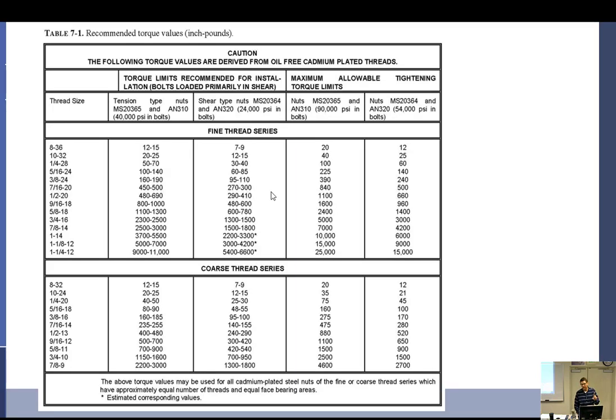First I go to the manufacturer, look for specific torque. Then the manufacturer's general. If there's nothing, I go to this chart. So I had a 5-6 bolt. The 6 — the length — means nothing to me for torquing purposes. The length of the bolt has no bearing on the tightness. What matters is the AN5 part — it's AN5, which is five-sixteenths.